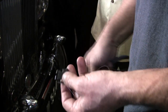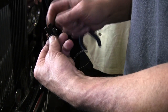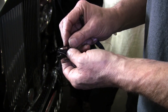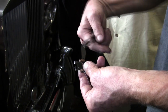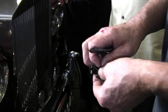All right. And if you look at your fuse holder, one side has got a chamfer and one side has a shoulder on it. See that? That's the side you want the fuse wire to be on. So the outer part of the folding tab, I call this right here the inner, and this is the outer. You want that to be facing so that when you push it in, it gets squeezed. If you flip it around, it's going to open up on you and break contact.